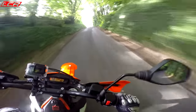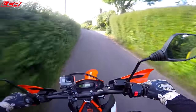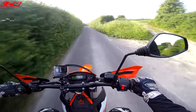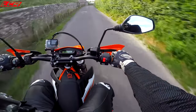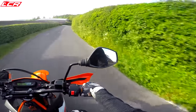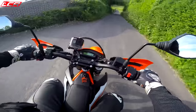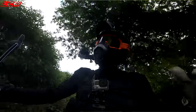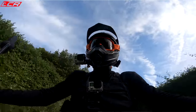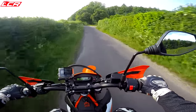The blipper, though, is fantastic. I love using the blipper — never had any problem with it. Off-road the blipper is really nice: you don't have to pull the clutch, you can keep your hands firmly on the bars and just knock it down. The quick shifter also makes a lot of sense off-road — you can hold the grip, support yourself, and just change gear.